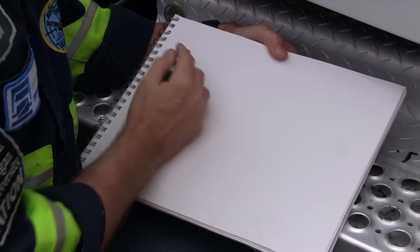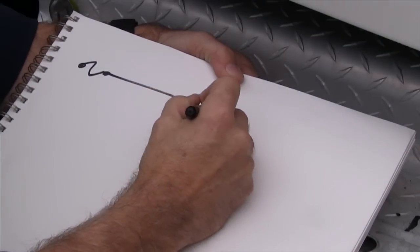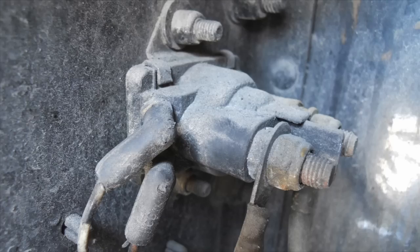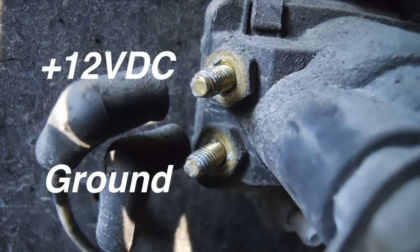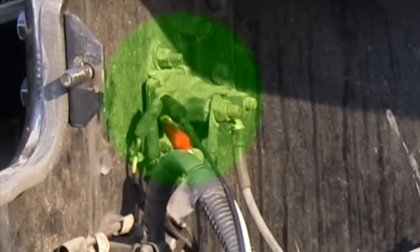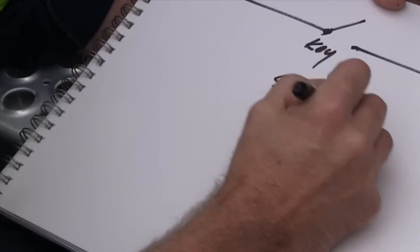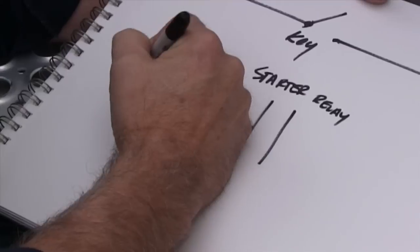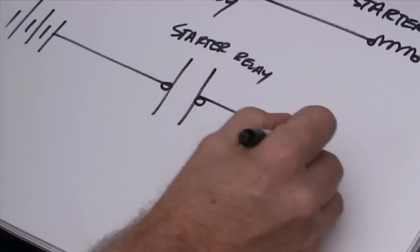Here's what the system is. There are three circuits. Starting with the key: we have a fuse, a key switch, and then a coil. That coil is in the starter relay, and that coil has two terminals on the side that allow you to put 12 volts right there. If you put 12 volts there, that coil should energize and the whole rest of the system should work - so that's a very simple test. If you want to rule all of this out, just put 12 volts there and watch what happens. The starter relay has a set of contacts. The starter relay contacts come from the battery - these are the two big studs on the outside - and then these go to another coil.